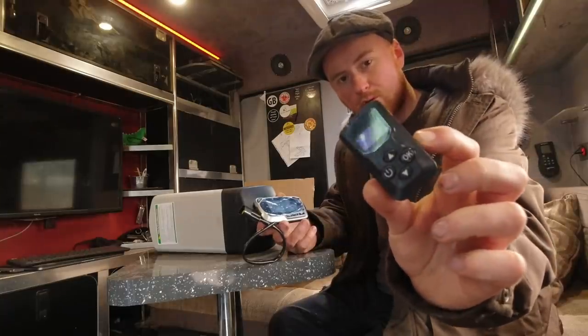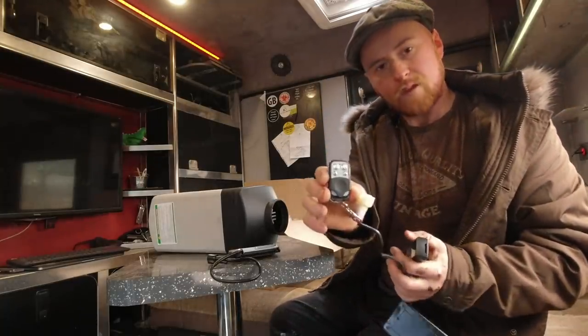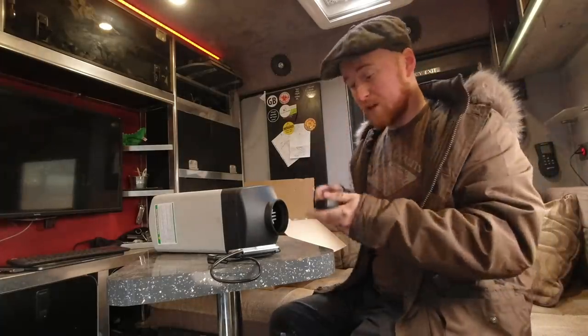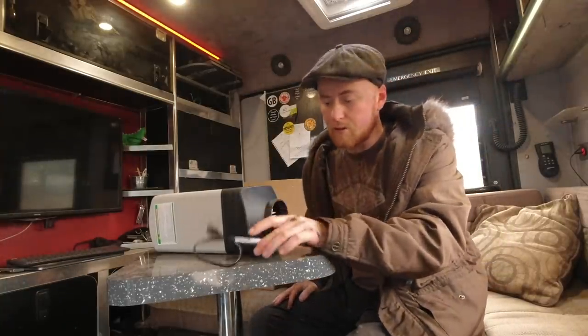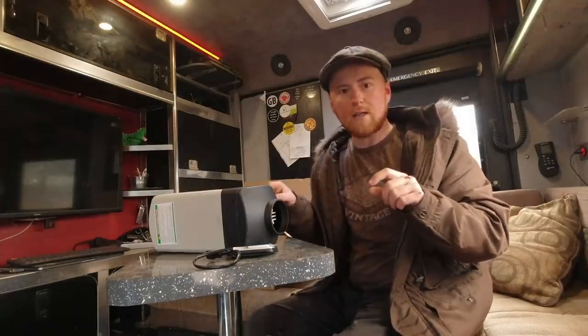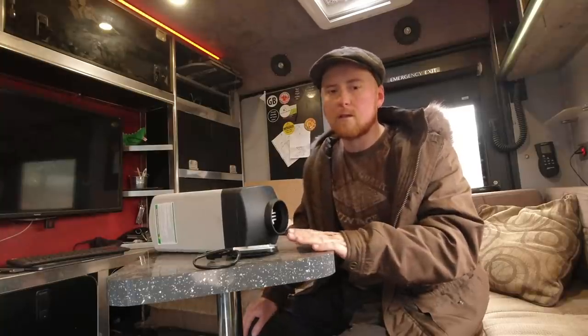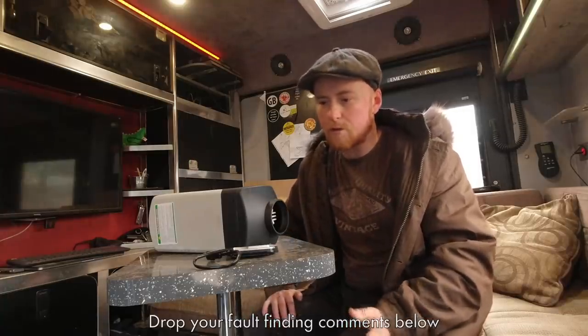I also went for an upgraded remote because it comes with a more advanced controller than just the standard on/off one. On my van there is no display and no control — it's just on, and you turn it to a number. What's different about mine is it's an ambulance — all the wiring is yellow with codes and job descriptions written on it, tapped directly into the Eberspächer wiring. I think what they did was remove the ability to control temperature to prolong service intervals — it's on hot all the time. It could be that the thermistor or thermostat is gone, or an error code I can't read because I haven't got a screen.